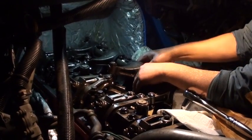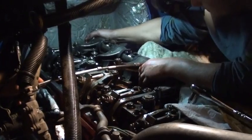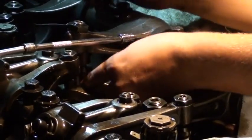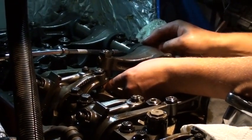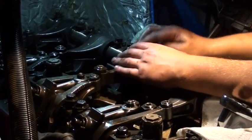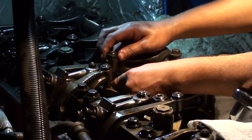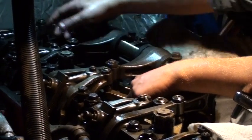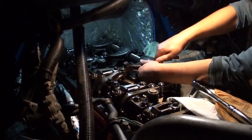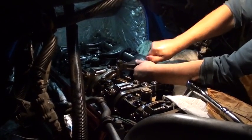The trick to the injector rockers and the rocker shaft is these spacers - these little spacers right here. There's one right there, a little gray spacer. See how it's turning? I can turn it, I can move it. Make sure as you're bringing this thing down that you can turn those spacers. They may get a little snug, but you should be able to turn them with your fingers - all spacers. Then bring the bolts down, and make sure those fit up in the head - align all the way to all three inside. Bring the bolts down and as you bring the bolts down, check your spacers after you start getting a little bit of stiffness on the bolts.